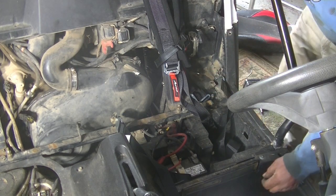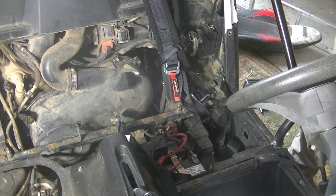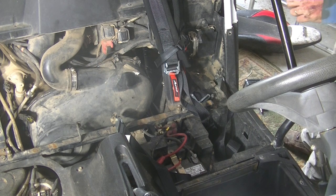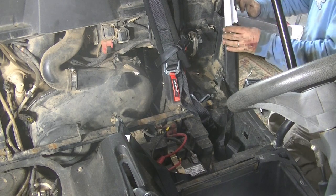Put that on there. If you use a drill or drill press, don't try to just hold on to the D-ring here while you're drilling it, because it's gonna grab on you. I know from experience. And it'll spin around and you'll get bloodied, baby. I did. So then I hooked it with a pair of vice grips and did it. That was smarter. Then I got even smarter and just put it in a vise and used a drill bit to finish it off with a hand drill. Let's see if we can get this out of here now.